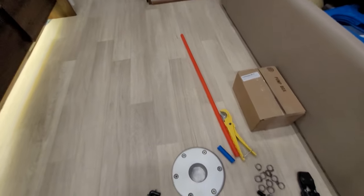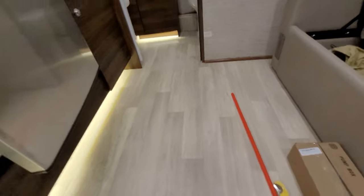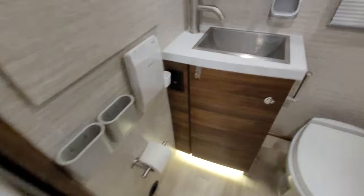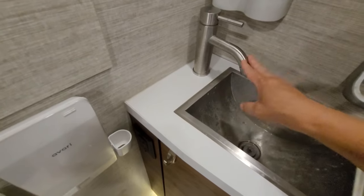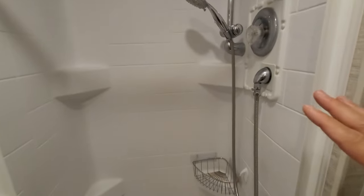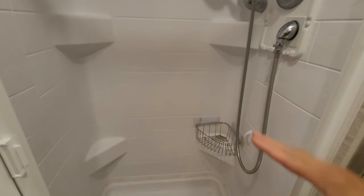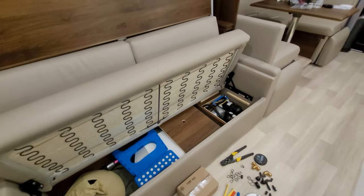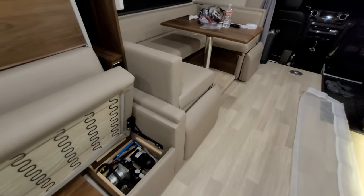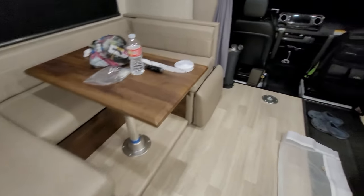Put the accumulator in and have some extra parts to take care of the clunking noise at the Truma water heater. Most importantly, it'll give you that nice steady stream of water at the faucet if you have these little aerators installed, and at the shower, and make that hot water consistent so you don't get that pressure spike going up and down. If you have any questions or comments, write them below — I appreciate you watching, hit the thumbs up, subscribe, and I'll see you on the next video.